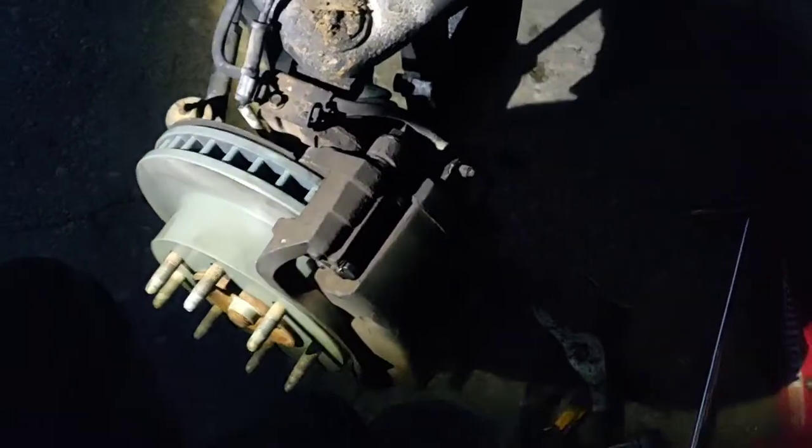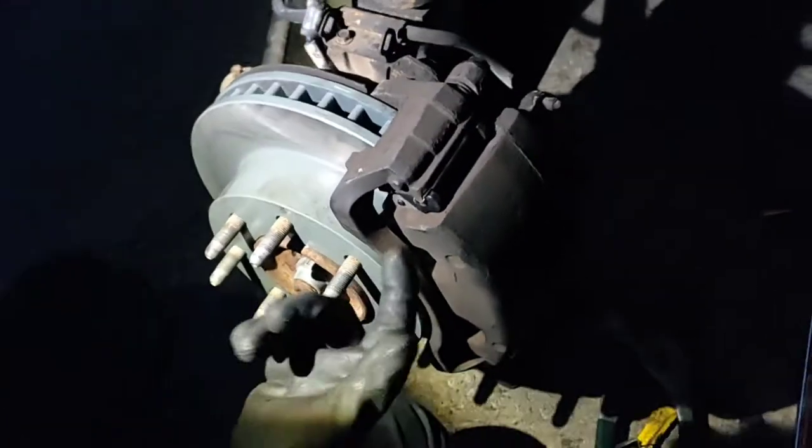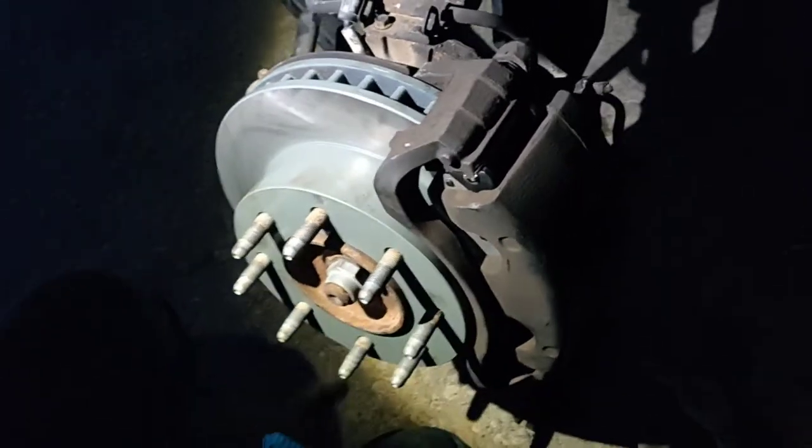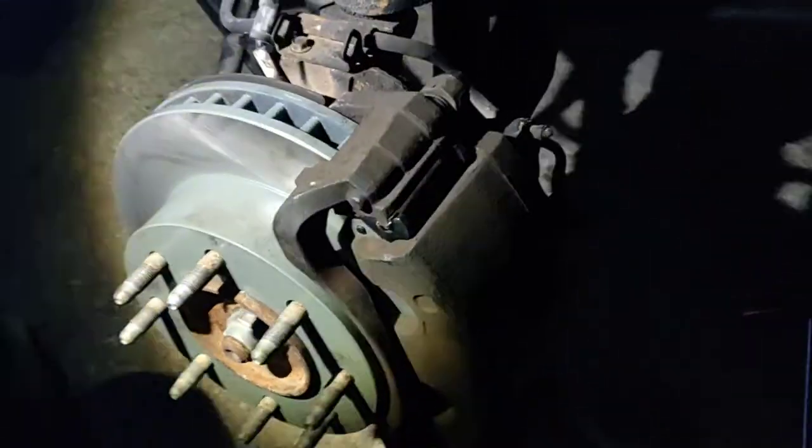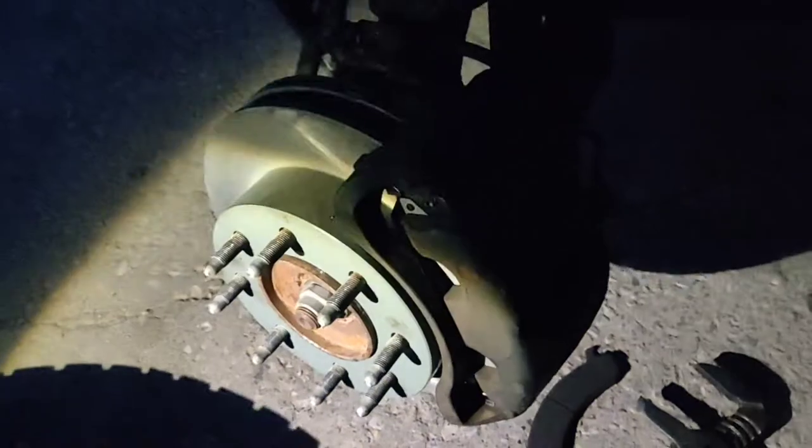And then you're to putting your wheel on. You'll want to torque these to about 95 to 100 foot-pounds. Between 90 and 100 is perfect for each of these. And do it here, then here, back and forth. I use my impact gun. It's a Milwaukee. On the first setting, it sets it right between 90 and 100. So I'll go ahead and show you.